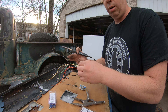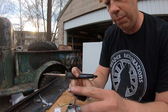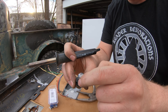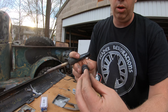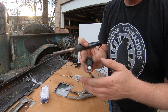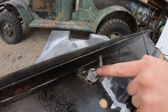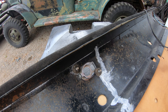On a side note, this is the switch and I copied the original knob here. It's not perfect but it looks pretty decent — I put some knurling on it. This one just twists from side to side. I'm not going to do it right now because it'll unthread and I'm waiting for the Loctite to dry. I put on blue Loctite because this switch, you just click it for left, click it for right — there's no in-between lockout. There's a hole on the bezel for the original lockout or selector switch and we're not going to be able to use that, so I'll have to come up with something for that, but no biggie.